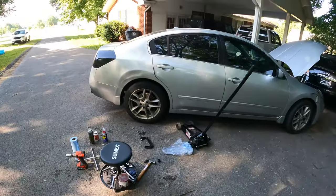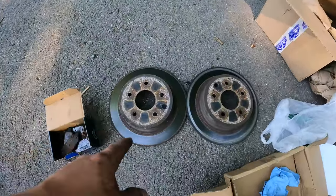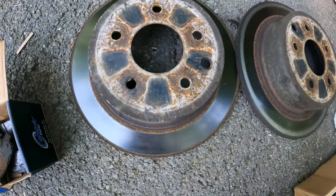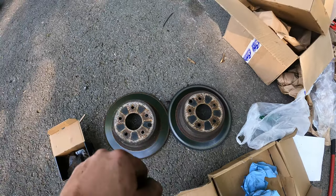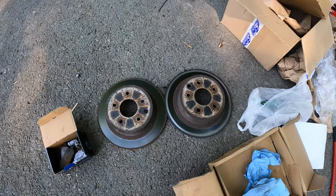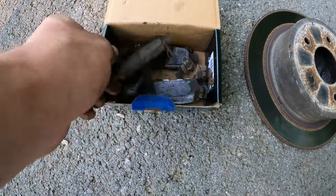Car's done, wheels on, everything wrapped up. Going to check the brake fluid and top that off if need be. These are all the old nasty parts I pulled off — the rotors don't look terrible but if you're replacing one you might as well replace the other, and the kit I bought came with both. Since it's a drum-in-hat setup in the rear, you do have to tap it with a hammer to get it off — just be careful not to hit the studs. A few taps around it with the hammer and you're good to go.